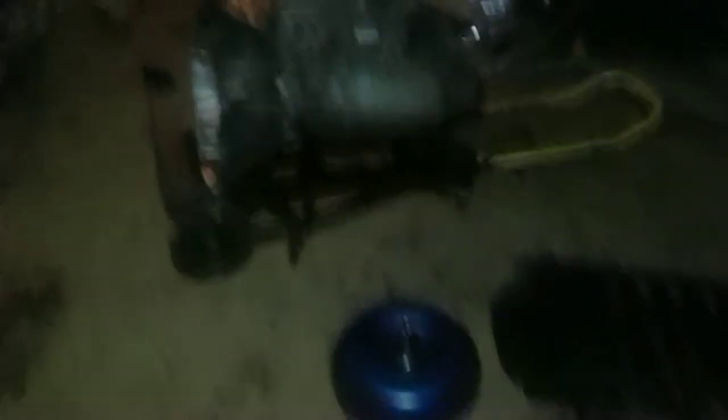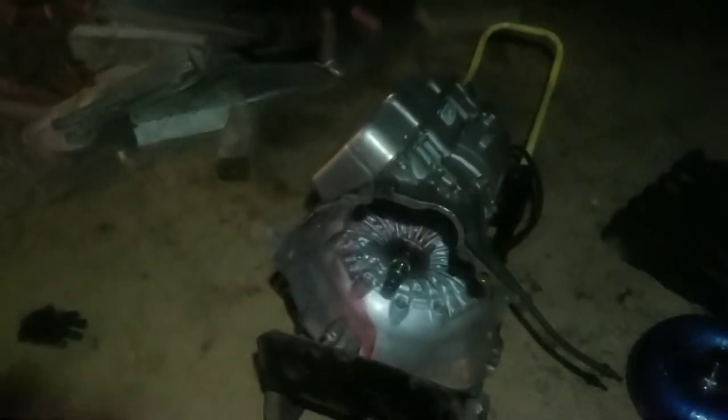Just like that, use your dolly and pull it out. It's very unstable like this — the torque converter is loose, so it can pop out and fall on your hands if you're not careful, throwing it off balance. Just be careful when you're doing this. Don't stay under it; it can fall on you and hurt real bad, so always be careful.